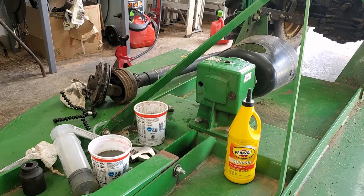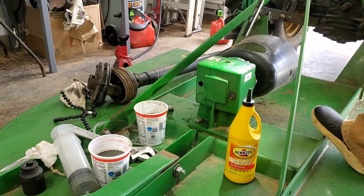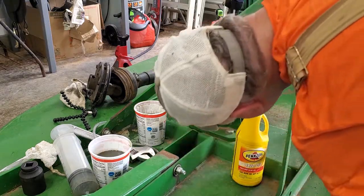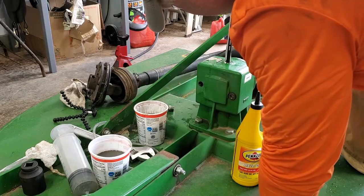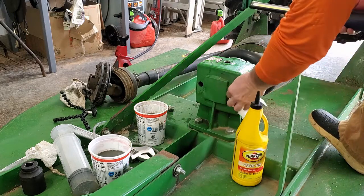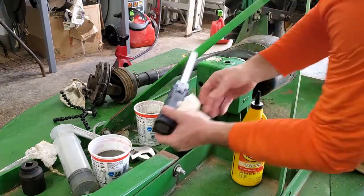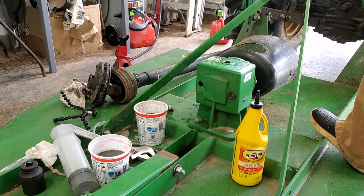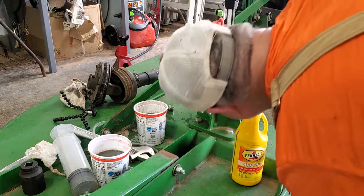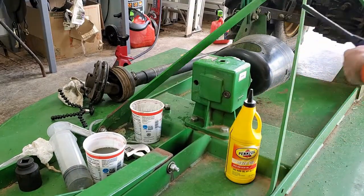I went and washed my hands to try to get some of that oil off — man, that is a mess. I'm not sure if you can see through this little sight glass or not. Yeah, I guess you can — just looking down in there to see how clear that was, so I could tell when I have it full to the proper amount. I guess you can do the same thing by leaving that drain plug out and filling it until it starts to overflow the drain plug. You can see at that little sight gauge there. Okay, so let's do it.